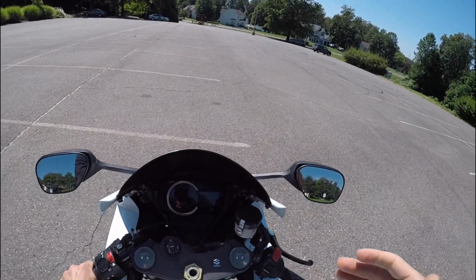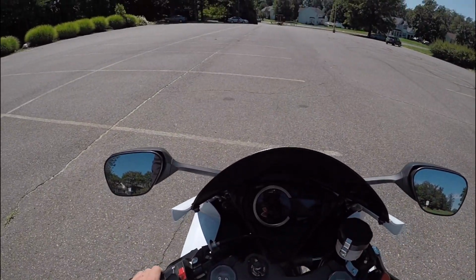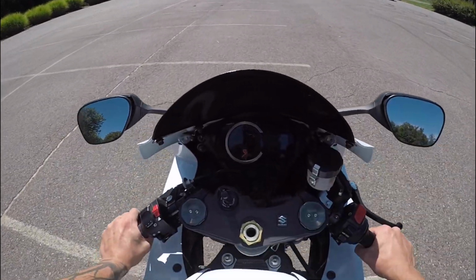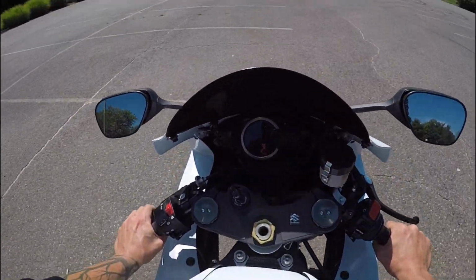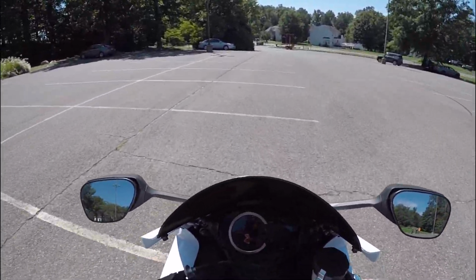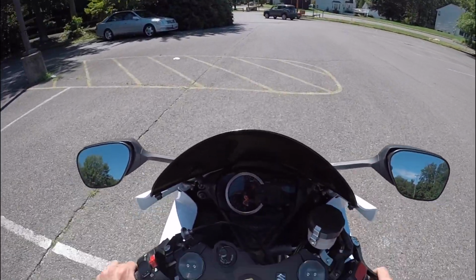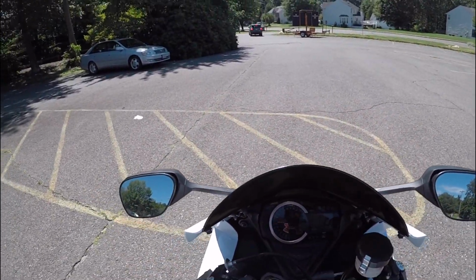Practice the same thing, but this time try and use a little bit of throttle. So watch, I'm gonna roll, have my feet guide me, 1, 2, 3, I'm up, my feet are on the footrest, and then let it out and just give it a little throttle, just a little bit. See, just a little bit. Now I can let off. Now I'm gonna use my brakes, pull in the clutch, apply my front brake and my rear brake, and gradually stop, okay? Just like that.